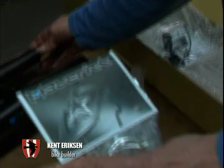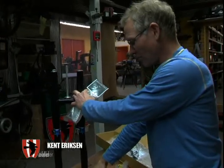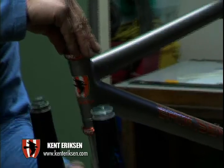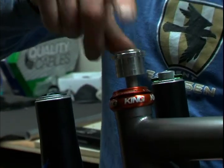The best thing about this fork is the lock down feature. It's still long until you hit a bump and it shortens up from a 125 to a 90. It's compressed air so it's still moving but it's kind of stiffer. So you can climb standing up and it gives you better position over your pedals for climbing.